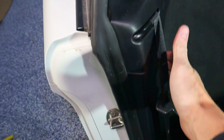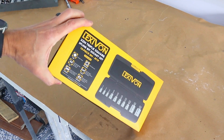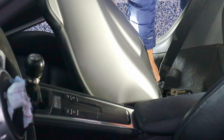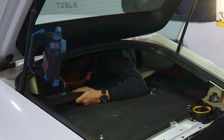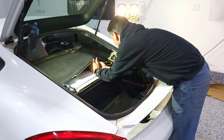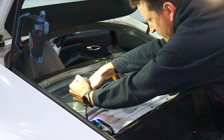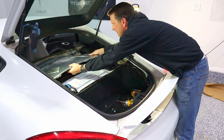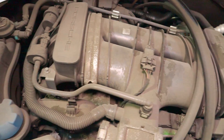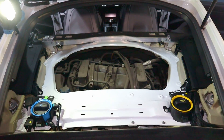On the passenger side, this is locked tight so I'm not going to be able to get this one off — I'll have to take off the seat belt from down there. This is the triple square, which is why I need to remove the seat belts. We now have access to the top side of the motor. As I'm disassembling, I'm also thinking about weight-saving opportunities — metal, sound dampening, and heat shielding that I think we can remove.